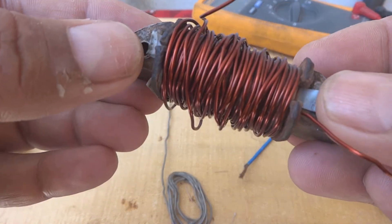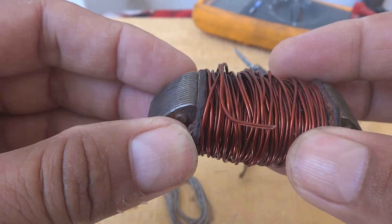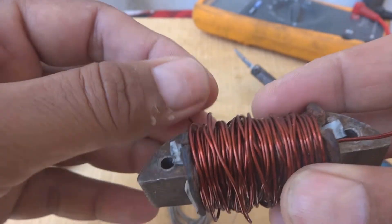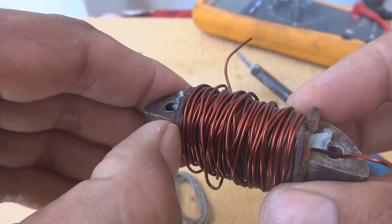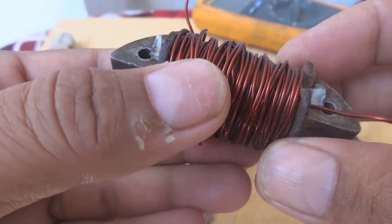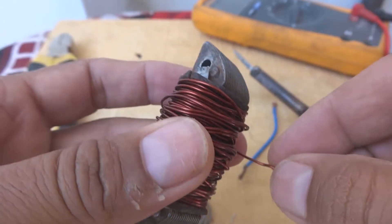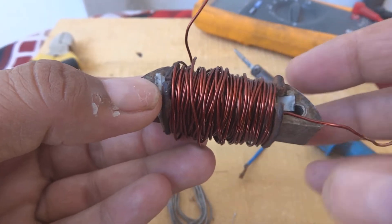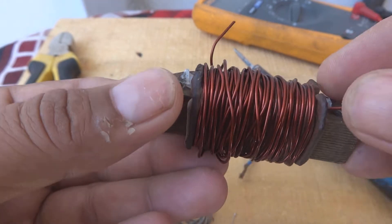Here is the primary coil — some people are calling it the primary coil, some are saying generator or alternator coil, which is producing voltage to the CDI. This is not actually for the CDI. You can see a very thick wire with few turns. This is for the contact points ignition system, as I removed this one from the bike which I showed you in the previous video. This coil produces around 12 to 15 volts, and this voltage goes for the ignition system to the contact point and to the ignition coil where it produces the spark.